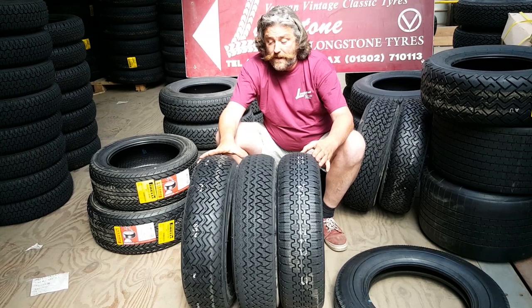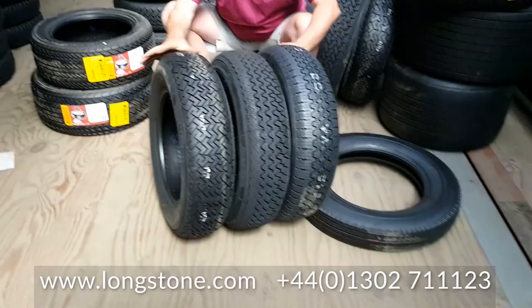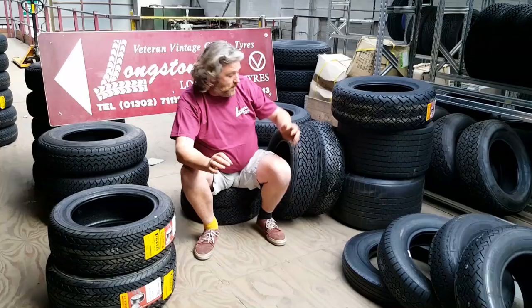So those are the tyres for these early Porsches. That one has the highest speed rating, but all three are excellent. If you want period-correct fitment for an early car, you want a Cinturato. That covers the 165-15s, which suit your 356s, early 911s, 912, and 914.